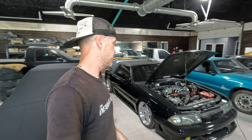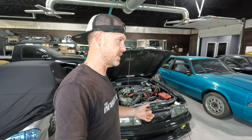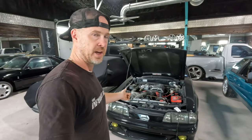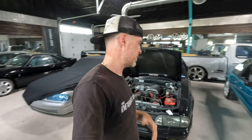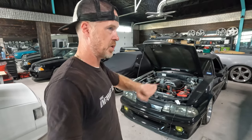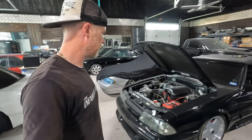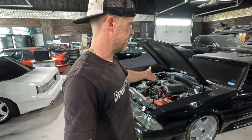For instance, my friend Charles actually swapped out the power steering pump because it was going out. He accidentally put power steering fluid in it instead of ATF. And so the pump kicks in and it kicks out. So I'm hoping I can drain the power steering fluid that he put in there, and at that point put the proper ATF in, and hopefully get that problem fixed, because it's kind of annoying to be like, oh, I got power steering, and oh, no, I don't. So that's an issue. Already talked about the clutch cable, so hopefully we're gonna fix that today.